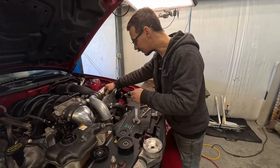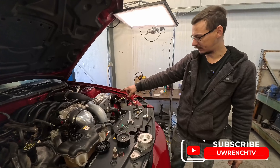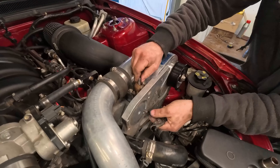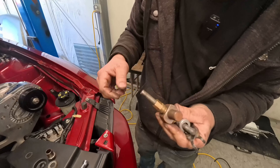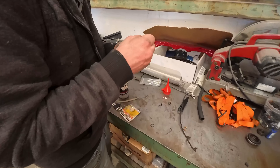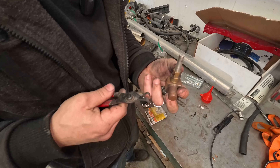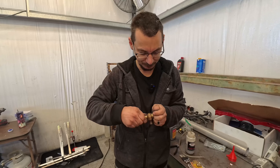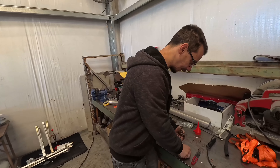I want to take this thing out - going to get my snap ring pliers and take that out. I'm pretty sure nothing is actually broken other than maybe this snap ring isn't as strong as it should be. Should just clip on that, and then that's your adjuster. I'm going to try to put it together right now and we don't need any extra parts. It's just been sitting on the car for however many thousands of miles. At least that's figured out - just have to make sure the threads are okay since they've been stuck in one spot for a long time.